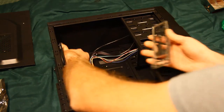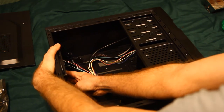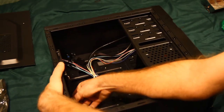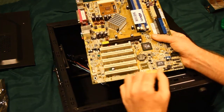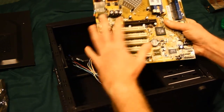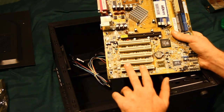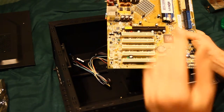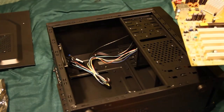One of the reasons I chose this case is because I needed a regular ATX case — most cheap cases out there are just for micro ATX, so the full ATX board wouldn't fit. I think full ATX has a little bit extra on it. Also the number of expansion slots was the main contributing factor, because a micro ATX case is going to be shorter and delete some of those slots. So I needed to find a case that would actually fit this board, which wasn't too difficult.